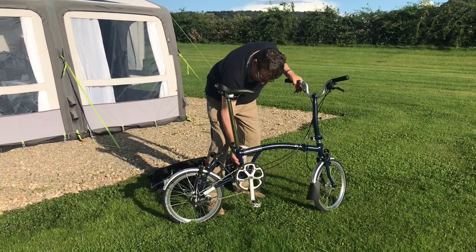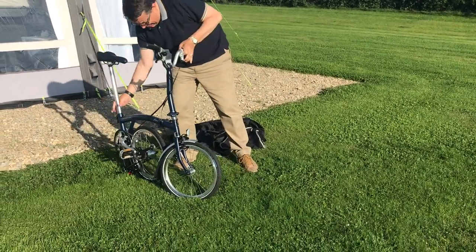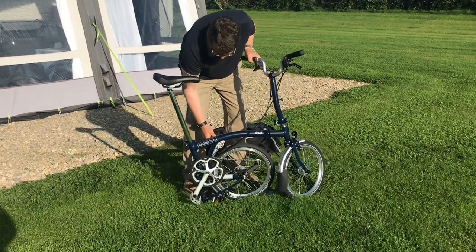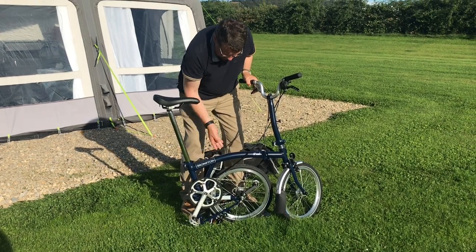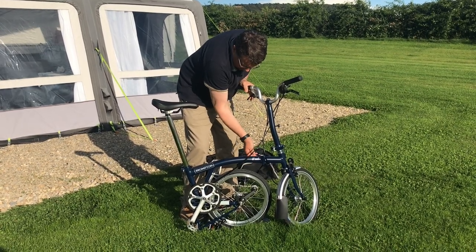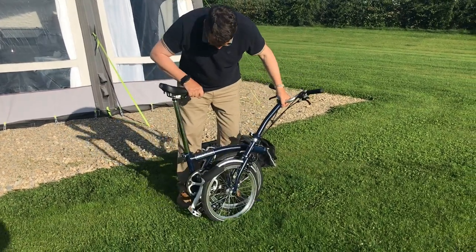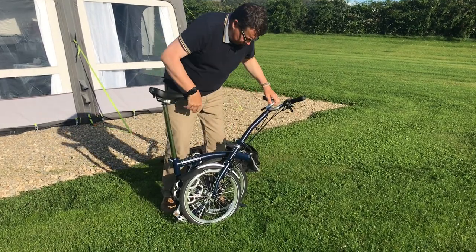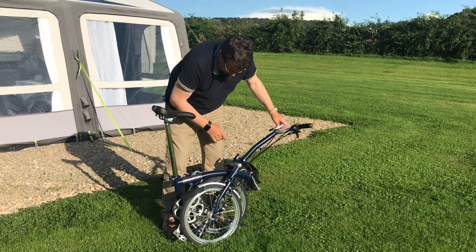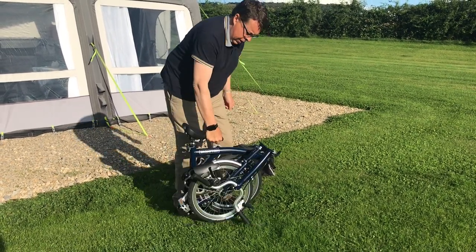I'll put a video on of me attempting to fold one up — it's not the slickest fold in the world but it is pretty compact. First thing you do is release the clip where the seat post meets the frame and swing the back wheel underneath the crossbar. This acts as a stand for the bike. Put the pedals in the right position — one of the pedals folds up. Then undo the clip on the middle of the crossbar, a quarter of the wheel along, and twist to hook the front wheel onto the frame supporting the rear wheel. Then undo the clip on the handlebar stem — that gravity-swings around and clips into a holder. Then the seat drops and you just pick it up by the seat.